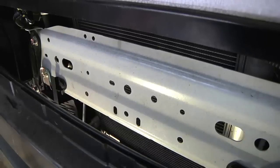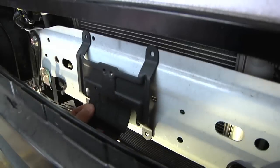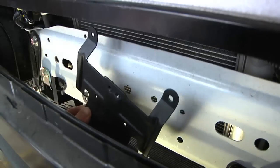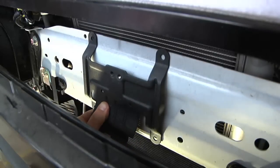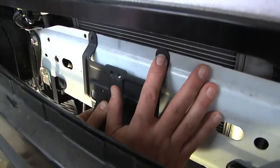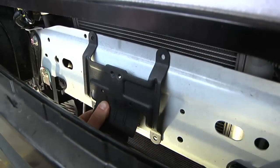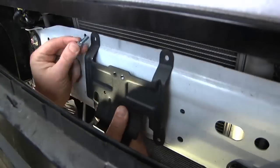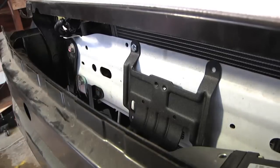We're at the front of the car. This is a plate right in front of the radiator and it already has some holes in it. Unfortunately I couldn't find any two that line up with the four holes in the bracket. There's a nice-looking hole up here so maybe I'll use that as a mounting point and drill another one. The bottom holes meet a little curve so that might be tricky to drill — maybe I'll try some self-tapping sheet metal screws. I'll temporarily start by running a bolt through here to test fit the heater.